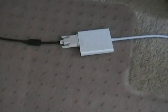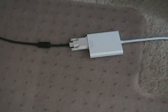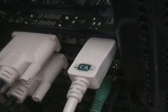Okay, I got my third monitor now all hooked up here. I have my DVI cable going into the Apple adapter. You can find these on Apple online or at any Apple store. I walked into the Apple store — they're about $99 for one of these adapters. It's a little expensive. They were supposed to come out with a cheaper edition but no one has been able to do it yet. I have the USB plugged in to get power, and then I have the cable coming down here — the mini DisplayPort male going into the female DisplayPort — and that cable runs up and hooks into the DisplayPort on my graphics card.